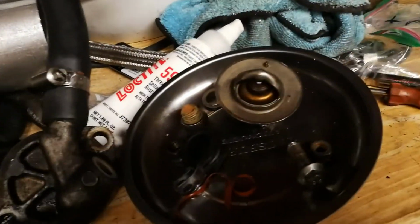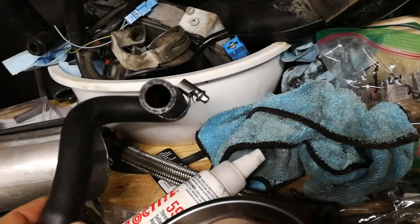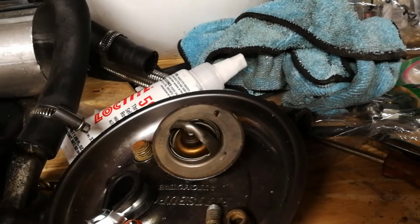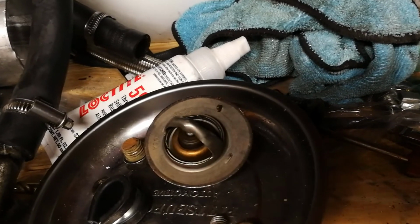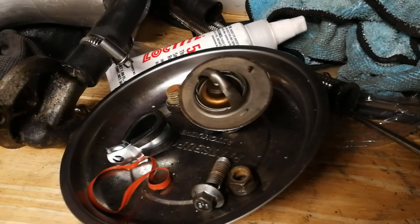And the 323 Mazda that I mentioned, they have what they call a bypass pipe, which is about this size, maybe a tad smaller. And the bypass pipe in that situation is bigger than the basically 1/8 hose that you have, the smaller hoses that you have in the Miata. So we want to make that be kind of similar, and so that way the flow will work correctly.